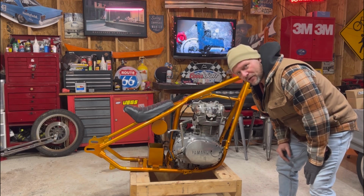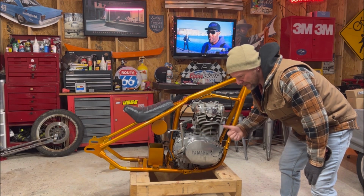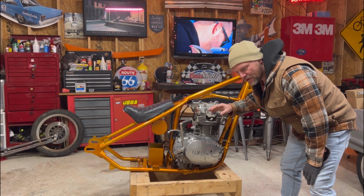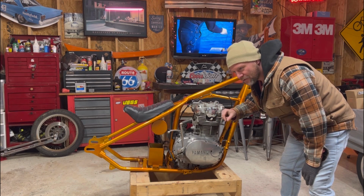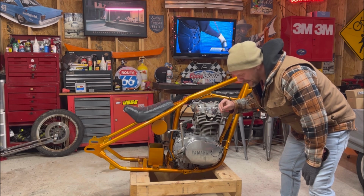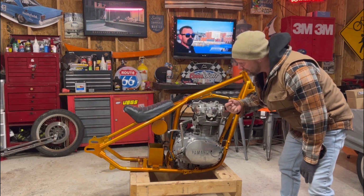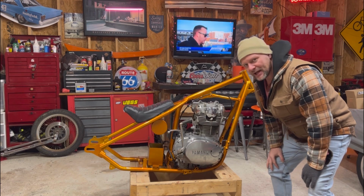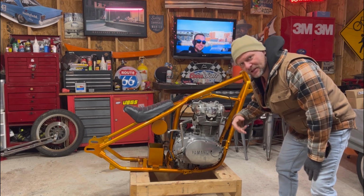So I'm going to go over to Mike's XS. I got to order my coils. I'm going to do that 2-in-1 coil. They do make one for points, just so if you're looking at it, you're going to need the one that's over 4 ohms. I gotta go order spark plugs, wires, a few other things. Mike's XS is probably one of the best places to buy a lot of the stock components from, the electrical components.